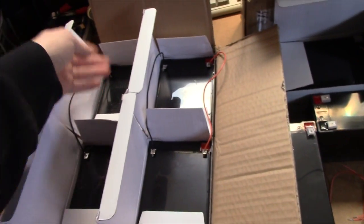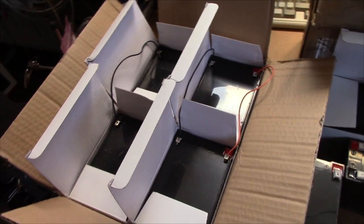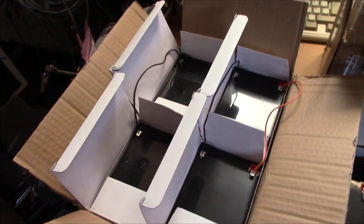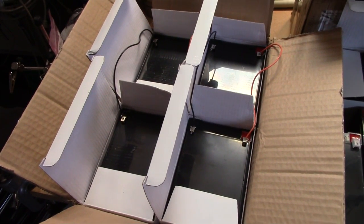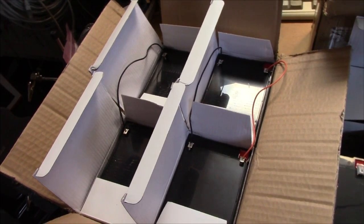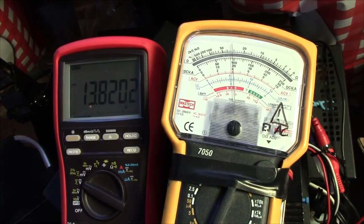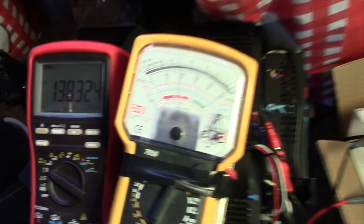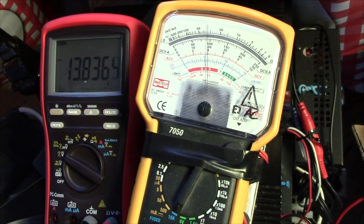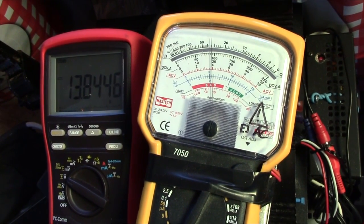You want to watch out for any sparks when you hook the batteries together, because if they are seriously differently charged — if one's got an OCV of 12.9V or 13V and another's got 12.4V — there could be some current running between them. It shouldn't be too much of a problem, but you might want to keep a check on them. With bigger batteries I wouldn't recommend doing that because you'd probably end up burning your leads. Then just let them charge for a while, preferably in a well-ventilated area, for a good few hours at least until they stop drawing a significant amount of current.